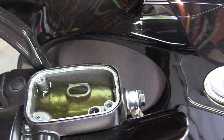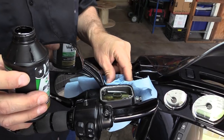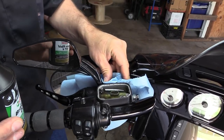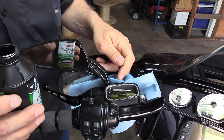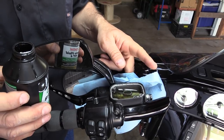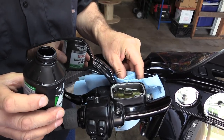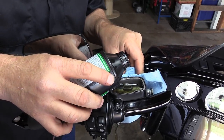You don't have to completely fill the master cylinder from push bleeding each pass — you just want to get all the old stuff out. Do it until the fluid is no longer opaque or cloudy. I still had a little bit of cloudiness in there, which means there was still some old brake fluid, but now that I've got it all out, I'm going to go ahead and fill it up.